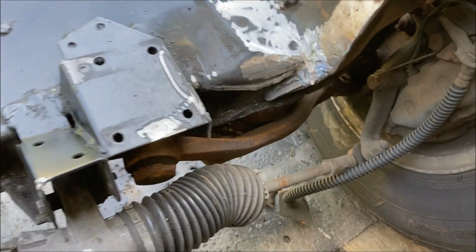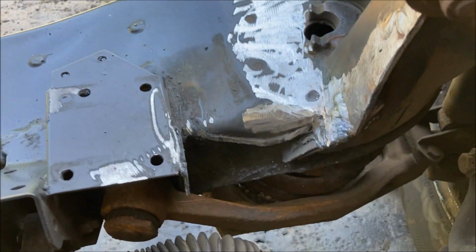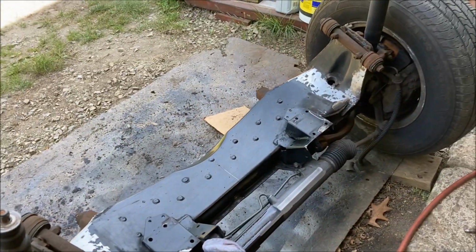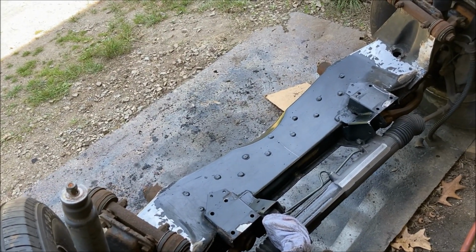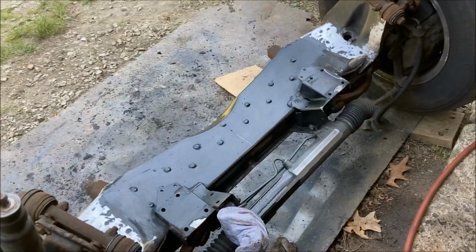Notches are made. I didn't video it, but basically I just put a cut in the back and knocked this over on each side, welded it up, and yeah, so now there's enough room for the 34-inch wide frame rails. I think I'm actually at 33.5, 33 3/4, but I set it to 34 to try to make sure I have enough room. We're almost there.